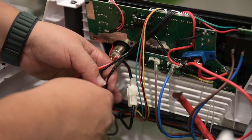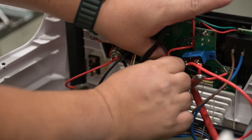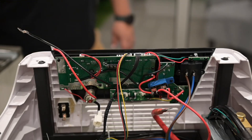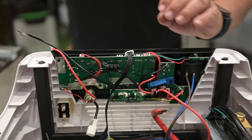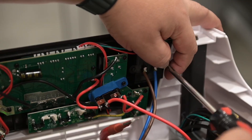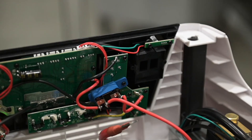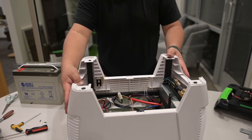Next, disconnect the black wire as shown, then disconnect the brown wire and the blue wire from the front panel by pressing down on the locking tabs and detaching them. Disconnect the 4-wire multi-color ribbon cable and the black 5-wire ribbon cable from the front panel. Using a Phillips-head screwdriver, remove the two screws securing the AC plug to the front panel, then set the screws and the AC plug aside. Now that everything is disconnected, lift up on the front panel and set it aside.